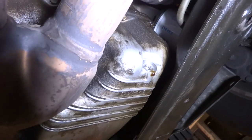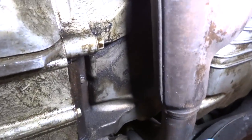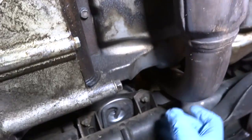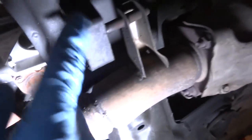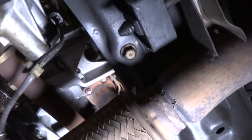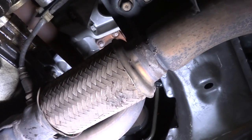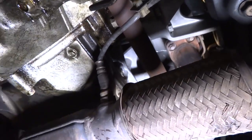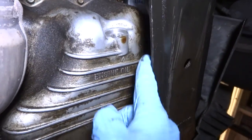To remove the drain pan would actually be really, really complicated because look what's in the way — the exhaust. This engine is transversely mounted, so it's mounted sideways and it's a V6. There's an exhaust header on one side and then on the other, so you'd have to unbolt both of those, then unbolt it from the cat and unbolt the hanger right here. That can be done, and thankfully I'm in California — a pretty dry state — so there's not that much rust or corrosion. I have air tools so it would actually be pretty easy, and there's good access to all these bolts. But that's still kind of a pain, and it's going to be difficult to get at some of the bolts on the side.